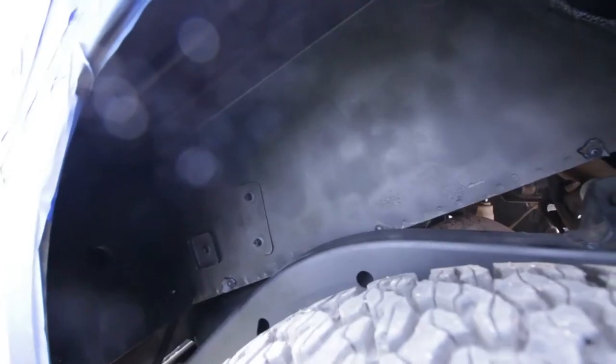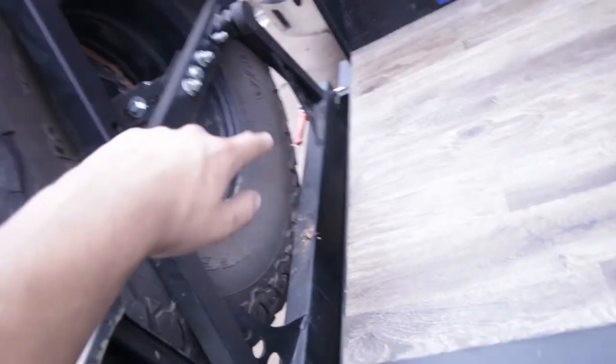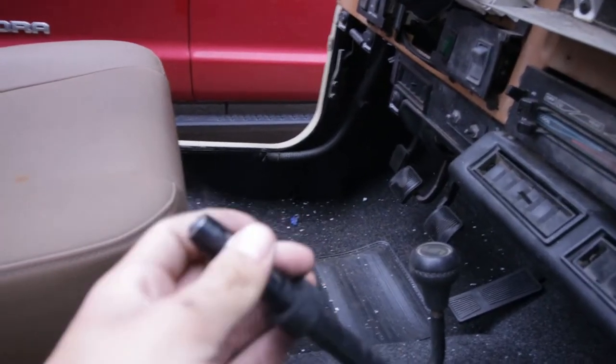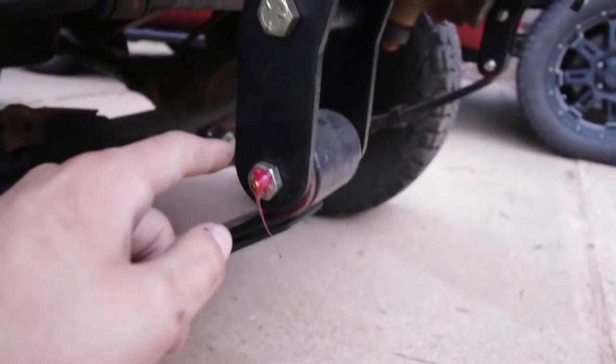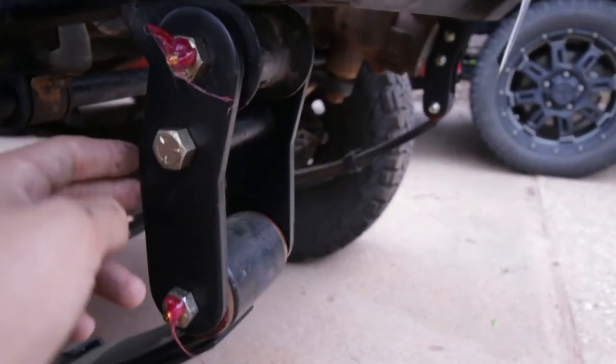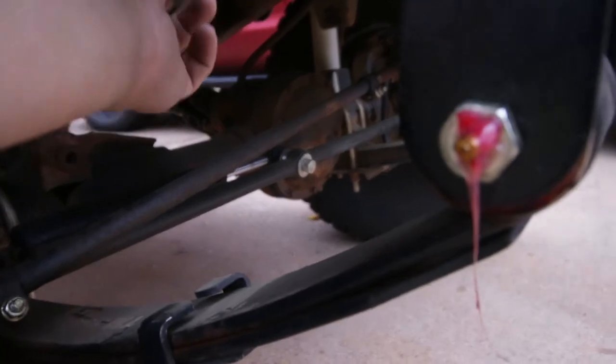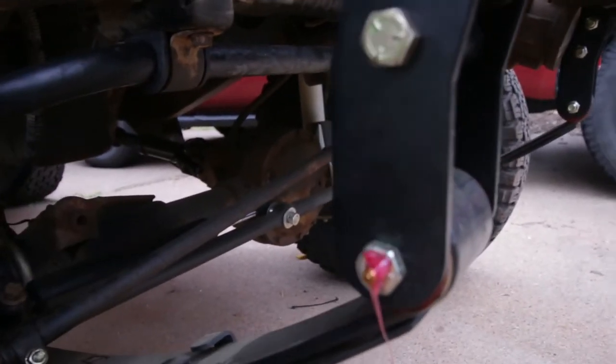Over here I did touch up paint on the Jeep just to make it a little bit better, help prevent any future problems. That looks a lot better. There are a lot of oil stains from my fingers, but the paint overall looks really good. You can kind of see up here — this is like a rubber coating. I put some on the frame as well, and that's just supposed to protect any mud or dirt from getting in there, prevent it from rusting. I also took the tailgate off so I can put the fold-up tailgate on there. And last but not least, I broke the shifter, which I still need to see if Jeff can fix. I changed out these bushings right here — these are greasable bushings and I made sure they're full of grease. These added about an inch of lift, which is awesome. I replaced the rubber on my track bar right here, the gasket just around here to help because one of them was completely gone.